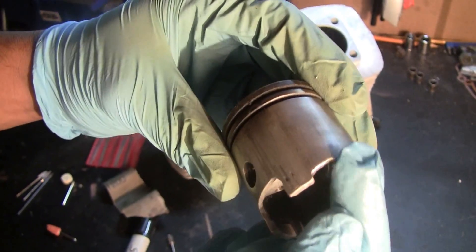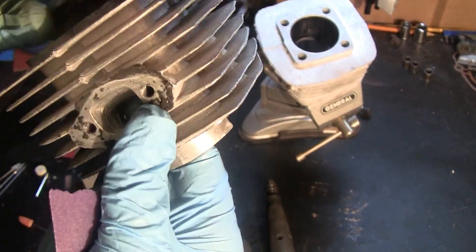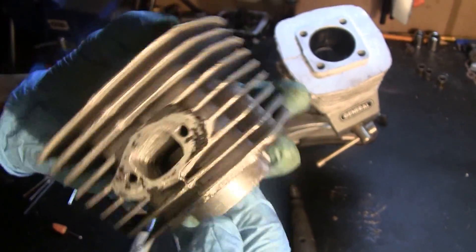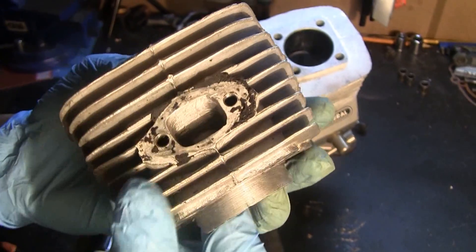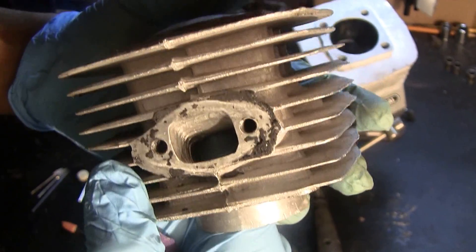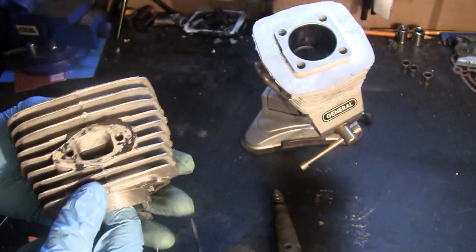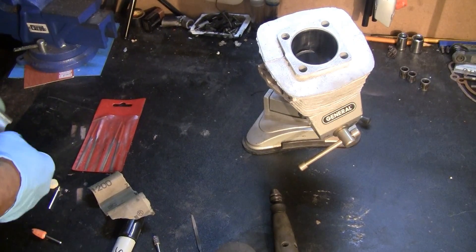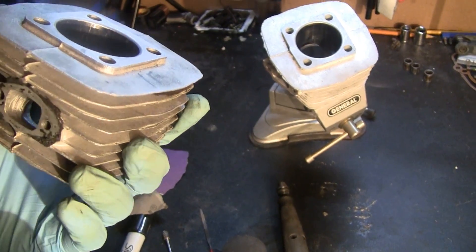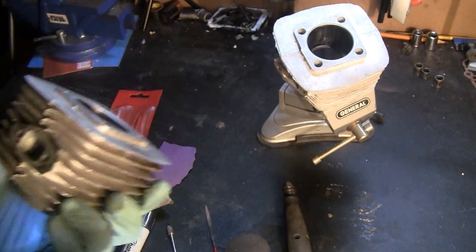You can take the piston to a grinder and remove that part of the piston skirt. What results is when the piston is at top dead center, the skirt is effectively ported, giving the intake more room so more fuel can get in while at top dead center. This helps a lot with fuel delivery. You can also raise the intake port, but that gets into changing the actual timing of the engine, and I suggest doing more research before raising or heightening anything.